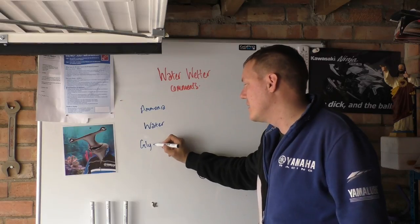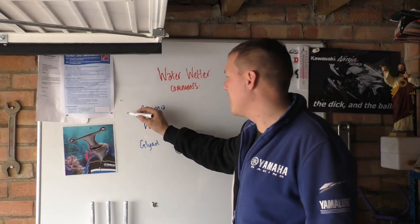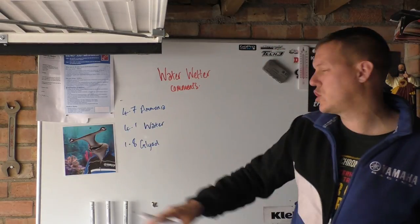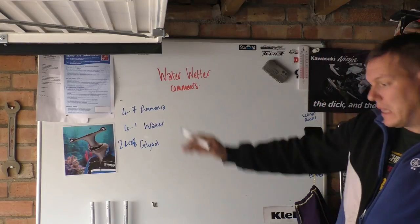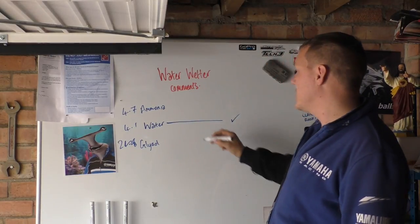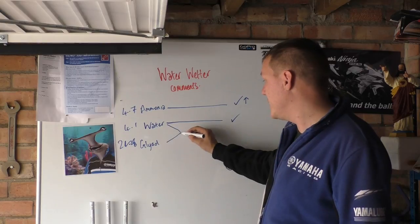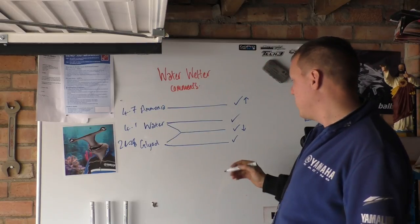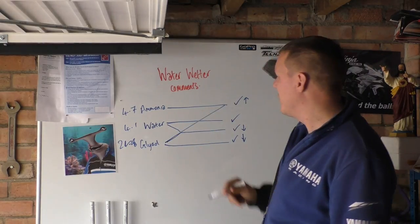So glycols are here. This is how good they are. I can't remember what the numbers are, but I think it's like 4.7, 4.1, and 1.8, or something like that, or 2. Let's just say 2, let's be generous. Regardless of what the units are, let's just go with their numbers. And as you can see, ammonia is the better. If you go water, you are going to get the best you can. If you go ammonia, you're going to go better. With glycols, if you go 50-50, you're going to end up here, but it's not as good as pure water. If you go glycols totally, it will work, but it's even worse. The only way Evans could be better is if Evans was made out of ammonia.